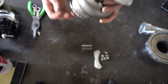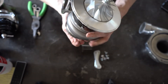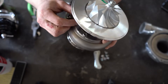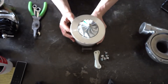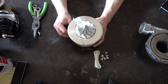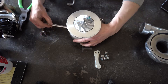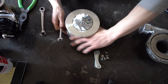When you go to put one of these bolts in, your flange is just going to hit up on it, but you can just turn it because it's not tightened all the way down — get it out of the way and get that bolt in. For now I'm just going to snug these because I'm going to have to clock it anyway once the turbo gets on the car, so I don't want them too tight so I'm not fighting with them later.